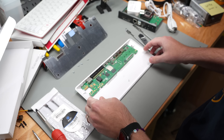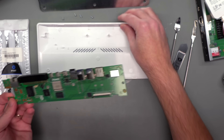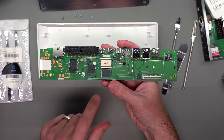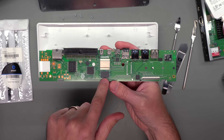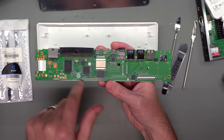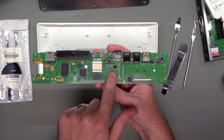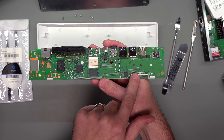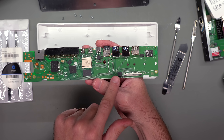And that brings us to this board — this is the entire Pi 500. All the other stuff is just casing. Looking closely at the board, in the middle is the SoC — the heart of it — and everything goes into that. There's also a RAM chip, LPDDR4X, and the RP1 chip which is like the IO southbridge going to everything else on the board. There are some traces coming over — not labeled — but they lead to some pads. You'll notice markings for 2230, 2242, 2260, and 2280. This looks like it should be an M.2 slot, but it's not populated.